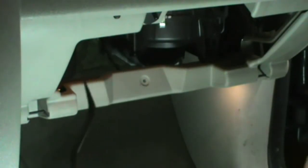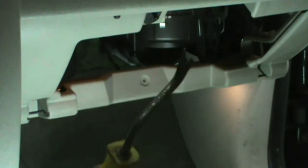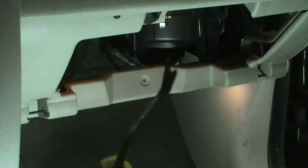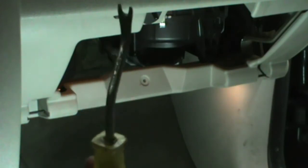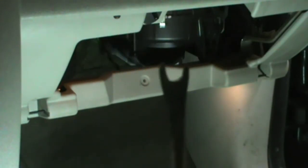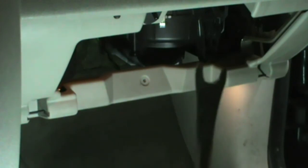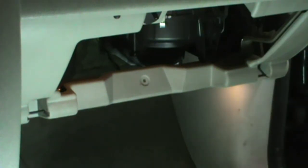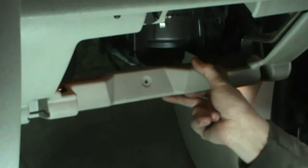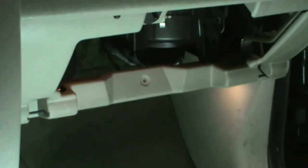This came in a set of cheap Chinese tools, a screwdriver set. It was supposed to be like a nail puller, but I just stuck it in a vise and used the vise grips, and I bent an offset in it, and I took my angle grinder and cut the notch in it. Works good for those little Christmas tree plugs that a lot of panels in a lot of vehicles are put together with, including these. If you don't already have one, why not?